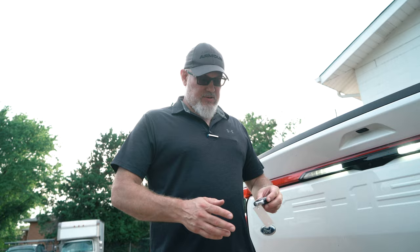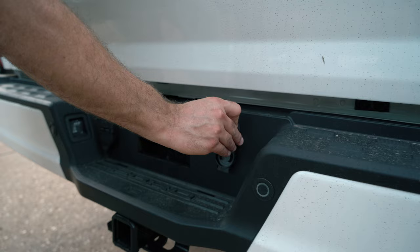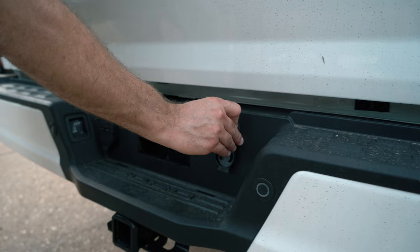The jack and tool kit are where they've been in the F-150 for years — passenger side behind the rear seat. Pull the tether, fold the seat back forward. They come out easier than in years past; they've got a T-bolt that holds them down nowadays — just unscrew the T-bolt and the jack comes out with relative ease. Once you have the jack and tool kit out, come back here — we still have a lock back here to prevent theft of the spare tire, so you'll need the customer's key fob. Put the key blade in, turn counterclockwise, and that releases it. Assemble your rods with the lug wrench, run them in to operate the winch that lowers the tire, take it out, and do your tire change.